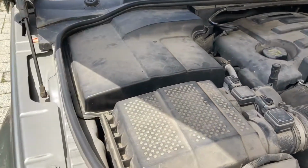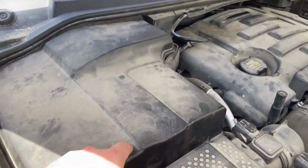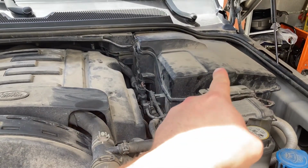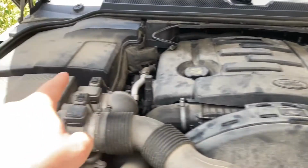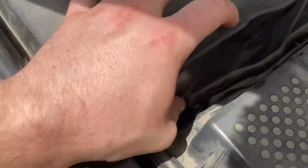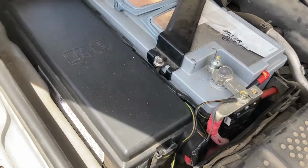And we begin by disconnecting the battery, because we're going to be working on electrics, obviously. It's placed here. This is a European model, not a British one, which means that that's where the ABS and brake reservoirs stay, and this is where the battery stays. So we just need to remove this cap. It just unclips relatively easily. I have to take it out to reveal the battery.